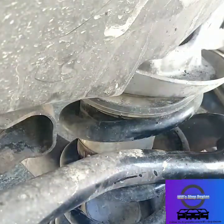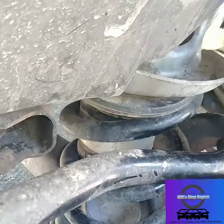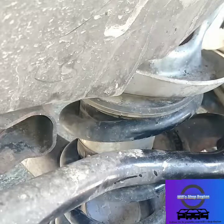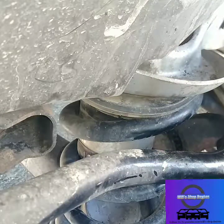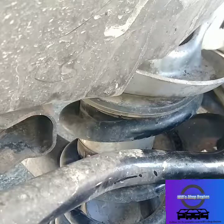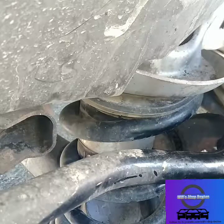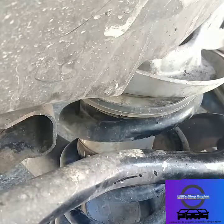Make sure everything's straight. I'm gonna feed my top one, then feed my bottom one, then we're gonna torque them down to spec — and we're pretty much done. That's pretty much how you change the rear sway bar links on a 2010 GMC Arcadia. I'm actually doing them both at the same time. Pretty straightforward, very easy — you can do it yourself and save yourself some money.